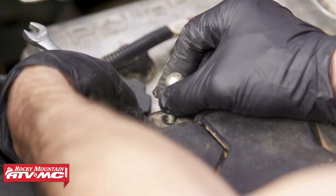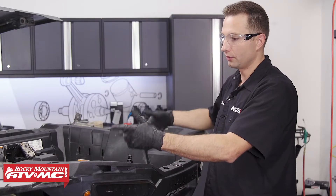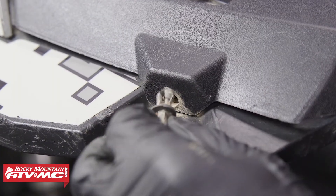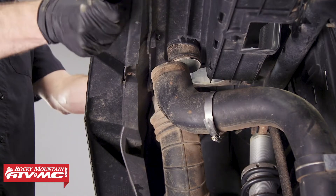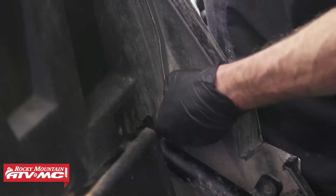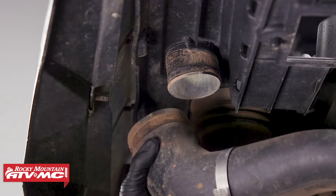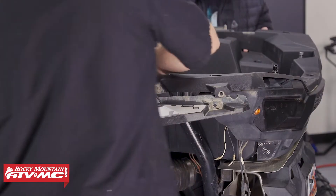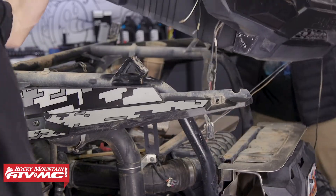To remove the cargo bed: there are 17 Torx head bolts in the back — remove those. There's a plastic clip on each side of the fender — remove both. Then remove the seven bolts on the front of the cargo bed, and pull the fenders out a little bit to release the clips in the sides. To successfully remove the bed, you have four trim clips on the front, three hoses in the bed to disconnect, and wiring going to the tail lights to disconnect. It's helpful to have a friend there with you to remove the bed.